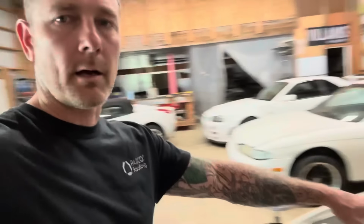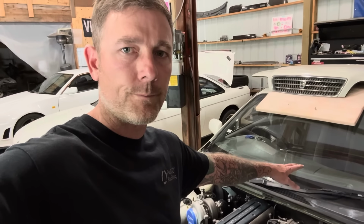So I'm gonna get started with, since it's all bolted in right now already, the transmission mount, because once I get that figured out, I can actually pull the transmission out of the car. Then tomorrow, when I get the clutch lines, I can install the clutch parts onto the engine and put the transmission back in with the lines hooked up and the mount for the last time.